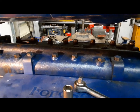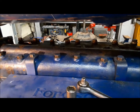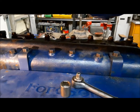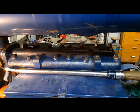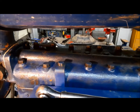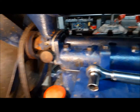The manual doesn't really give you a lot of information. It gives a tightening order but it doesn't really give you a torque value. They're half-inch bolts so I'm going to wind them up to 80 or 85. If they feel okay I might go as far as 90. I'll do it in two steps — first step at 50, second step at at least 80. 90 is a little sketchy with these old 1950s bolts, they might take it, they might not. They're all torqued up to 85 now and nothing felt spongy. Now I'll do the four water pump bolts and that'll be it for tonight.